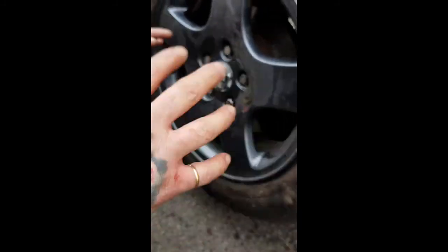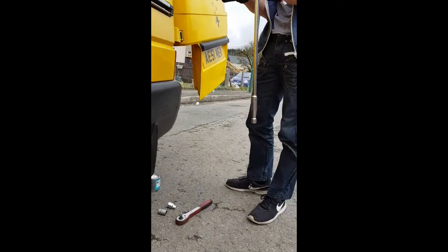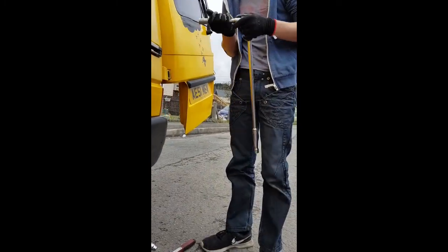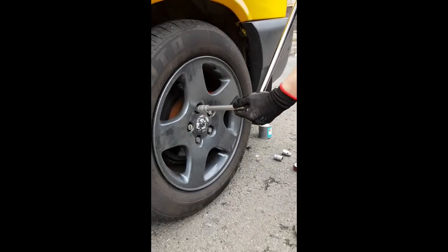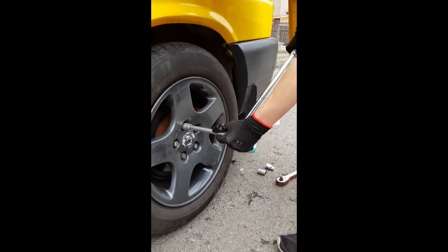What we'll do now is take it off the axle stand, let the tyre go down onto the floor, and then using the big bar I can tighten them up fully so the wheel is on nice and solid. Right, so we've got him down off the jacks, all the axle stands are out, he's sitting back on the floor. So Logan is putting the socket back onto the long power bar, and he's just going to make sure that the nuts are done up tight.